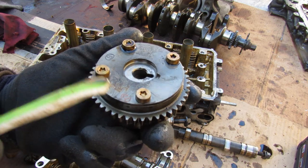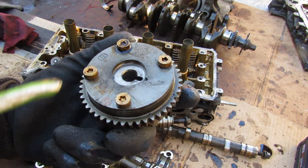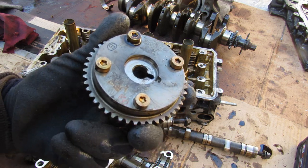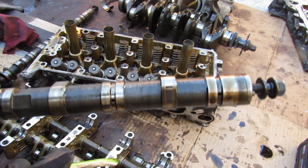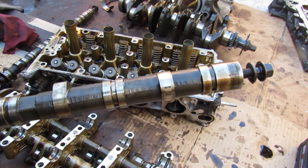Some Hondas and Toyotas suffered from variable valve timing actuators rattling on cold starts — I've got another video linked in the description if you want to check out why that happened. Some people have also noted that K-series exhaust camshafts tend to wear out a lot, which could be due to a worn-out rocker starting to eat away at the camshaft and causing a ticking noise from the top end of the engine.